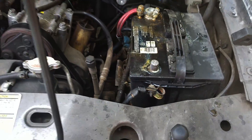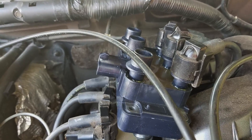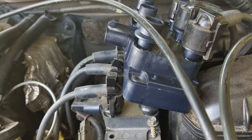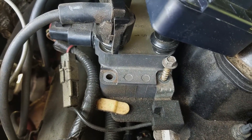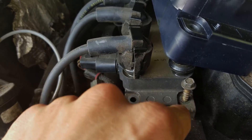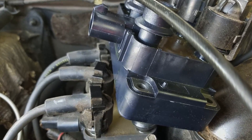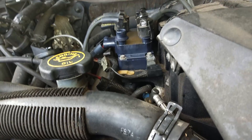You can see exactly what I'm talking about — I have the old plug wires hooked up, doing one at a time so you don't get anything crossed up. Once I take the bolts out of this I'm gonna make sure and do each one of those one at a time. And of course you have the plug right here you've got to disconnect. There's a screw there, screw there, and then there's two in the back. Do them one at a time so you don't get them crossed up, because if you do it's gonna take a minute to get them straightened out.